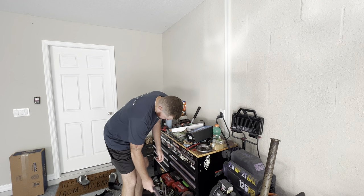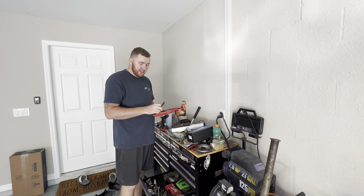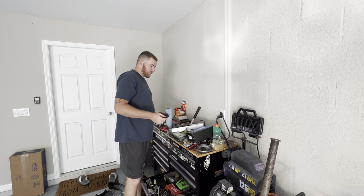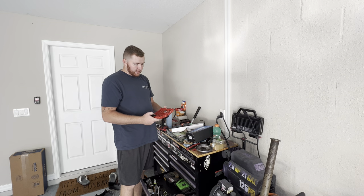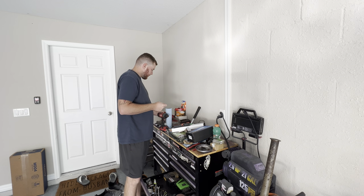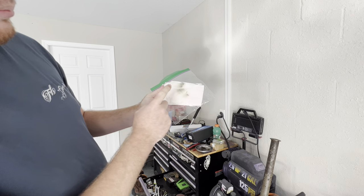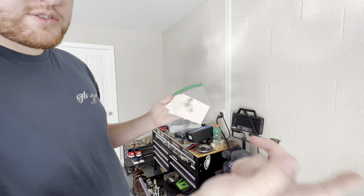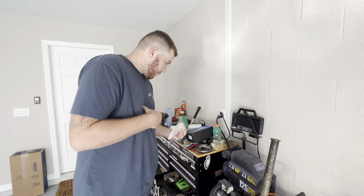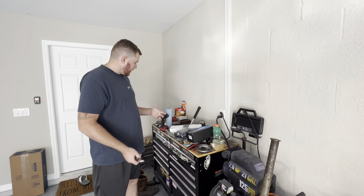While I get my drill ready, I'm going to explain what's going on with my truck. I think I've found out why I'm having torque converter locking and unlocking issues. It's locking and unlocking while I'm driving, which makes it feel like it's slipping going into overdrive — but my transmission fluid is perfectly fine. This oil here is from my dipstick on one side and from a transmission bottle on the other.